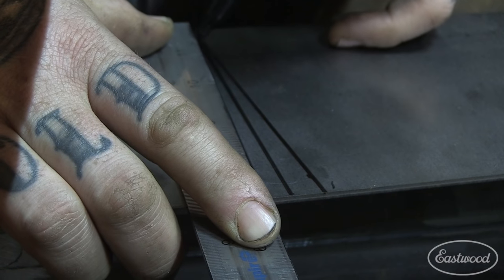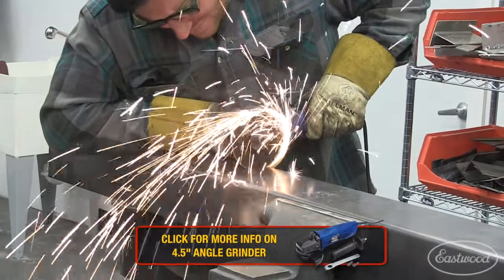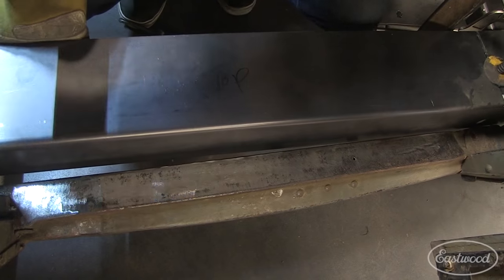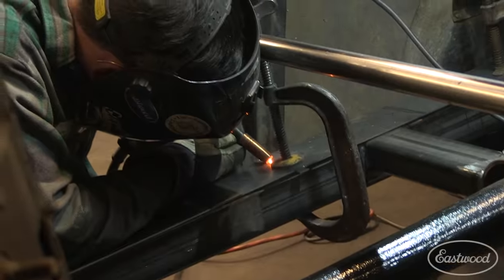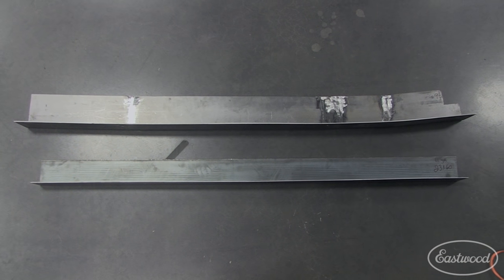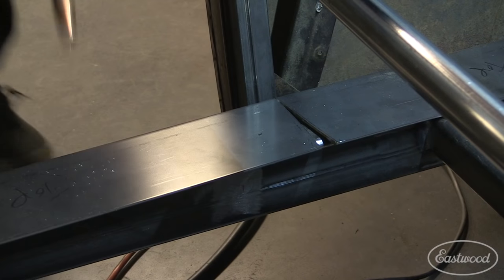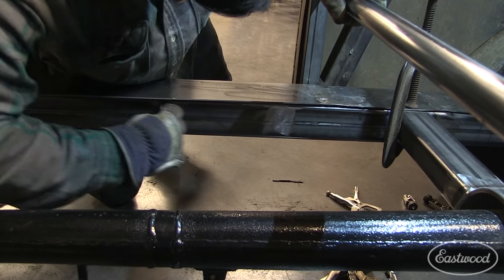Because the body of a Model A pinches in at the front and the rear, we needed to modify the side rails to match the same profile. We took small pie cuts out of the rails at a few spots around the A and B pillars that allowed us to pull the side rails out to match the original inner rocker area. Because we made pie cuts, the gap of the cut was closed up as we bowed the rails outward. We then clamped the rails in place and welded up each seam locking the shape into the side rails. When we originally had the side rails bent up, we had the top portion made a little wider than needed since we didn't know the final shape until we modified it. With the side rails back in place, we marked out the excess material and trimmed it off with the plasma cutter.